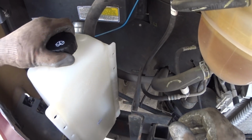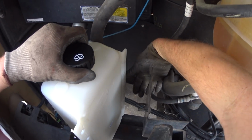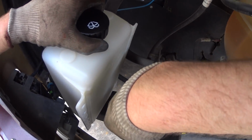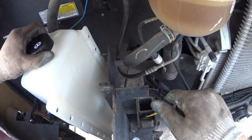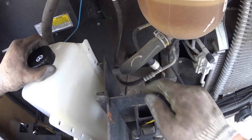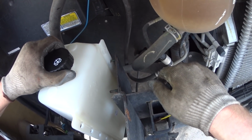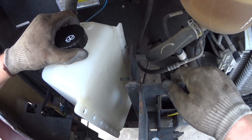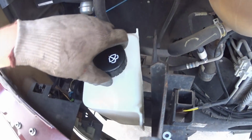So what I'm going to do is I'm probably going to go ahead and retain these 2 screws here. I'm going to cut these off with a grinder, and then I'm going to probably have to weld in something on this side to accept that. So I may have to drill in a new pilot hole here because these don't quite line up exactly, but not a big deal. Won't take much to do that. So I'll take a little break, get some tools, come right back to it.